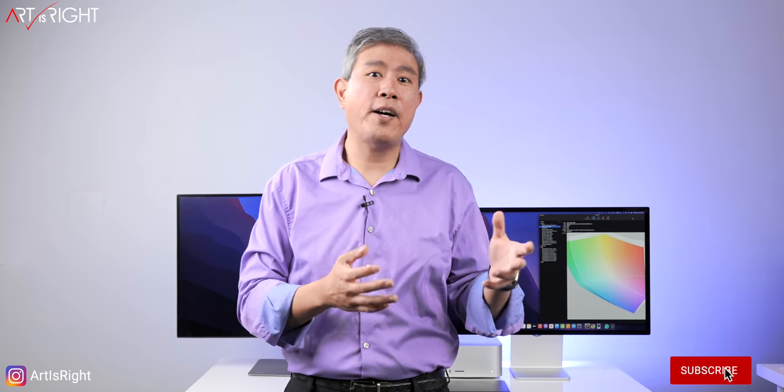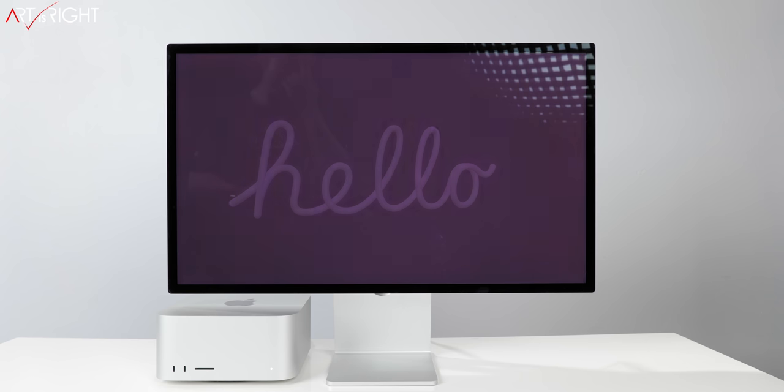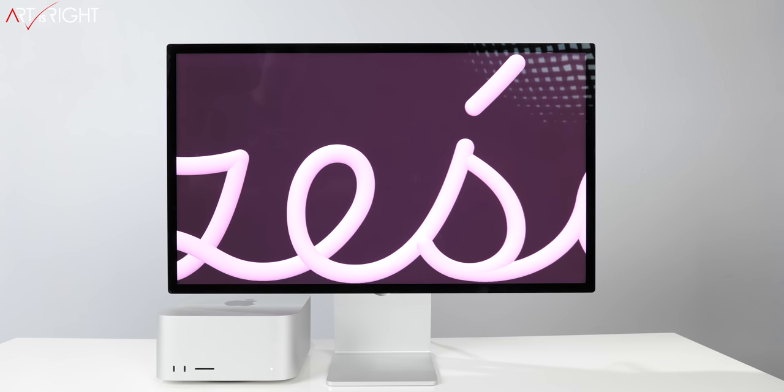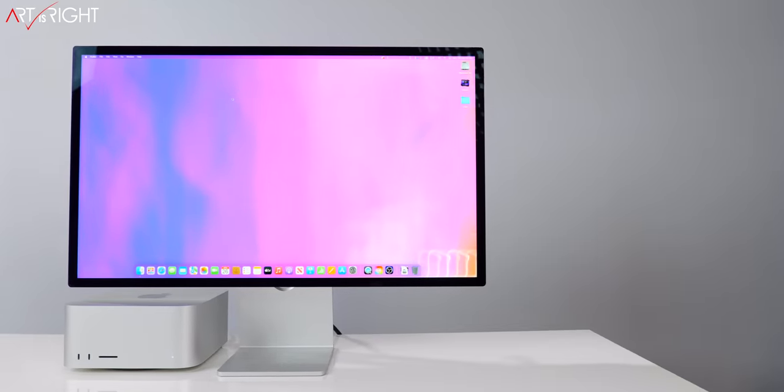In order for a display to qualify as what Apple calls Retina — or HiDPI in the PC world — you generally want a pixel density of more than 200 pixels per inch. Most displays on the market right now don't come close to this unless they are 5K or 6K in certain sizes. For instance, a 27-inch 4K display is around 163 PPI, and a 24-inch 4K is about 184 PPI — still not crossing the 200 PPI threshold. Some say images look blurry below that threshold, though it depends on individual perception; some have no problem scaling 4K, while others find it doesn't work well because they pixel-peep.